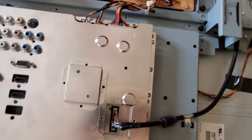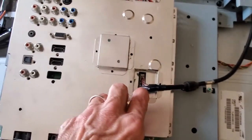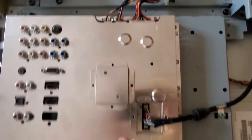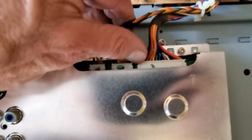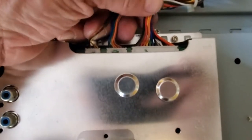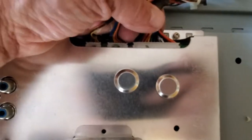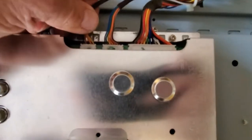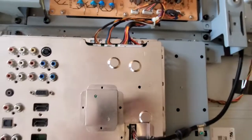Now I am ready to put the back cover back on. Not too many things had to be disconnected to get the board out besides all these screws. This is the power connector — make sure you push that back in. It goes in and out the same way. To take these out, just use a screwdriver, push on one side, pull it up, push on the other side, pull it up a little bit, and wiggle it out. To put it back in, line it up carefully and push it in gently one side at a time. Tug on it a little bit to make sure it's secure — don't tug too hard or you'll pull the wires out.